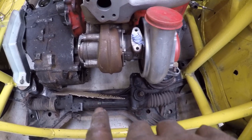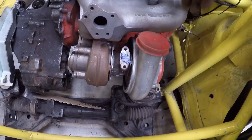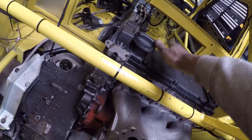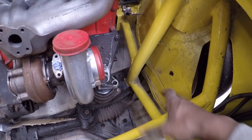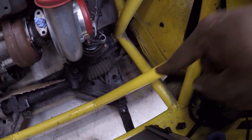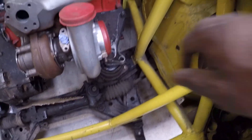On the compressor side, it's going to come out of here, go up across and then up into the intercooler, through the intercooler core, come out down, and then across into the inlet manifold on the air filter side. I'm just going to have a 90-degree bend to bring the filter around roughly here, and then have a snorkel duct in the tailgate which will force air down across the filter and then out the bottom — relatively simple in the rear.